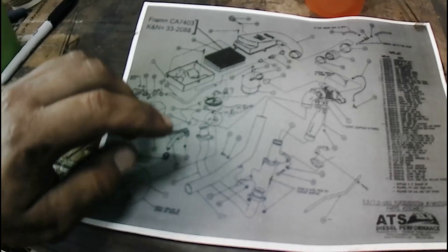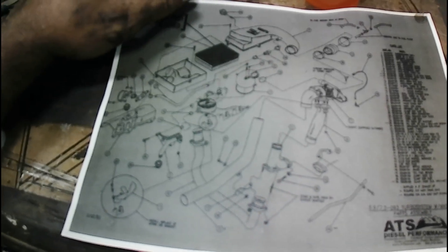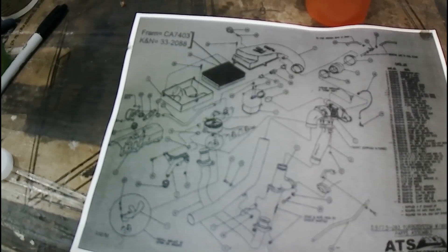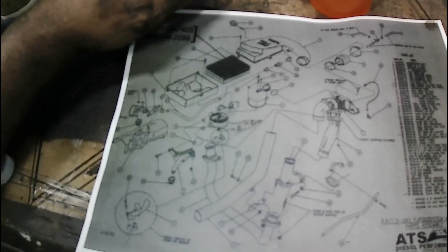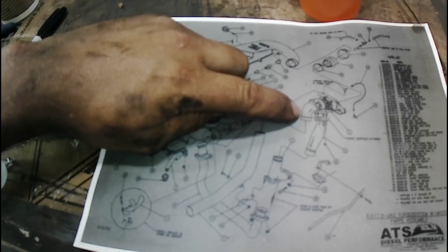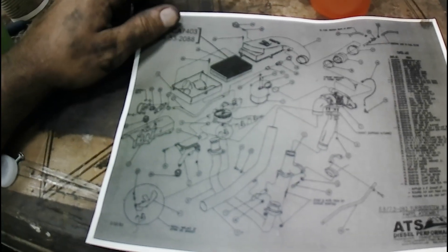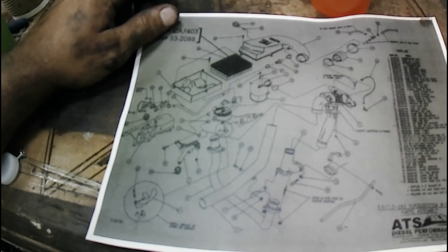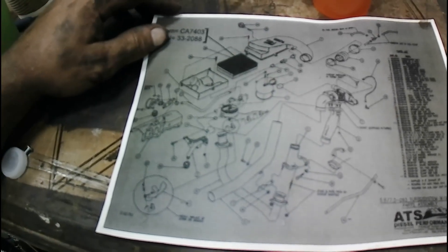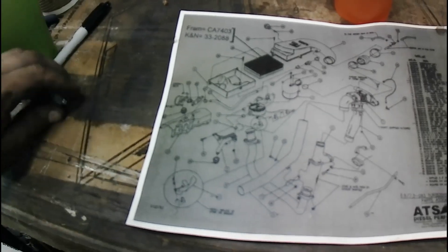The next problem I'm working on currently is the downpipe. According to this diagram here, I do not have the downpipe — it didn't come with my engine I bought for the turbo. I've also got another problem with the dipstick tube I'm going to have to address later for the tranny — that's a totally different setup. What I'm thinking about doing is welding on a flange up here — this is a friction fit, goes inside, and then it bolts down onto some tab I don't have. My theory is if I weld on a V-band and weld on the other half, I can fab up my downpipe and tie on with the Diamond Eye system all the way to the back.